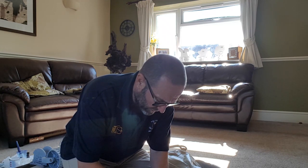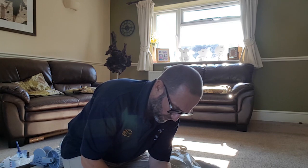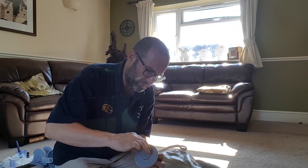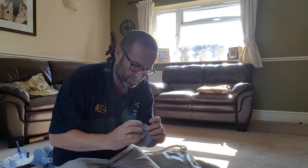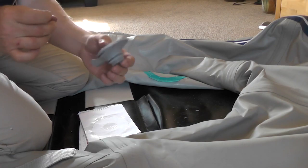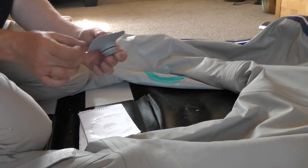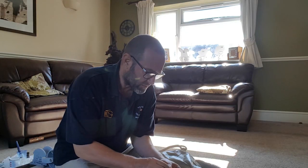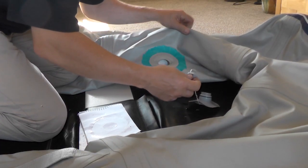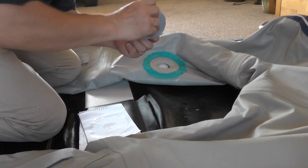It's been two minutes. One thing I noticed is that some of the glue dripped through the hole, and I don't want to squash this down and stick the two halves of the dinghy together, so I've shoved a bit of paper towel in the hole to stop that. I'm placing the patch on my plug first to help line it up perfectly over the hole, then the plan is to take the plug out, smooth it down, and make sure it's stuck.